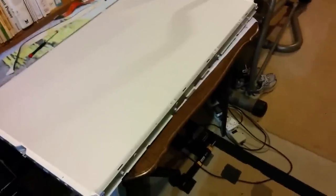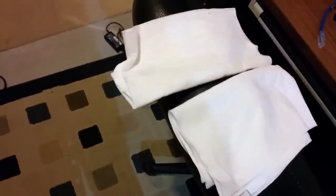So now would be a good time to clean. Here's the LCD. This is the side that's going to be going down. I've placed the T-Con connectors towards me because I'm going to be putting the connectors on, and if you remember these flippy guys, this is going to be downward, so the T-cons connect there. So this is the bottom side. Now is a chance to clean it as best as you can. I hope buffing it with a lint-free cloth isn't a bad thing. I'm also going to use a lint-free cloth as handles, just so that I can grip the outer edges of this before I place it on top, and not leave any fingerprints on the bottom side.